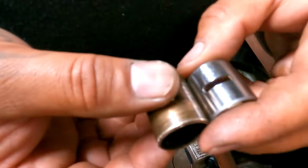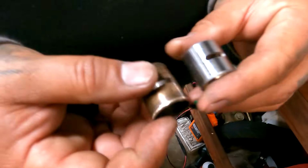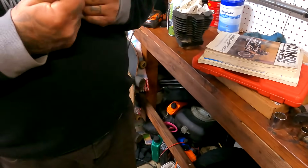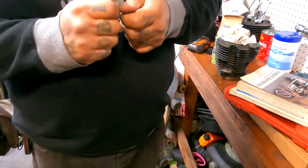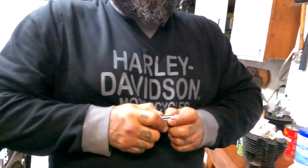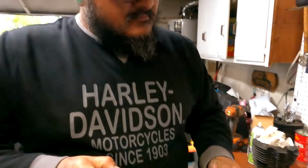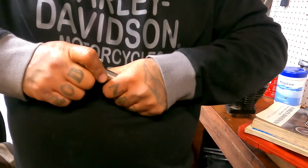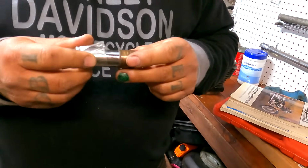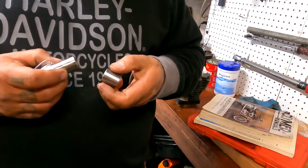Dang, this one's shorter. No, but not by much though. And so now we're gonna open the wrist pin up. Oh yeah, so there's a whole thing, right? Oh, it's supposed to be, oh no! It's not just a tight fit, it's supposed to slide through there? It should go in. So what did she give us? See, that was too much play, right? And this one's not enough?